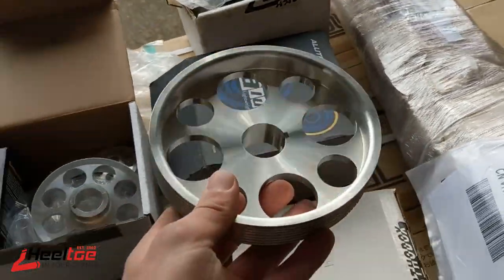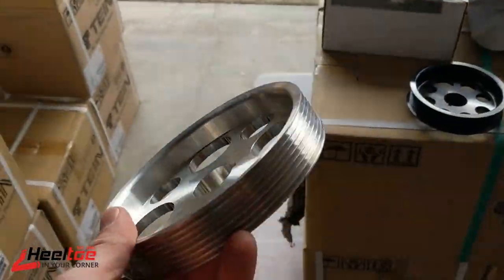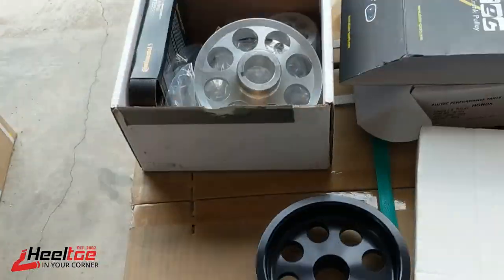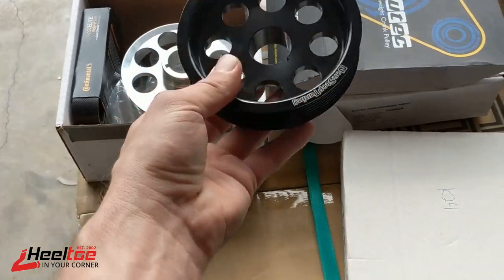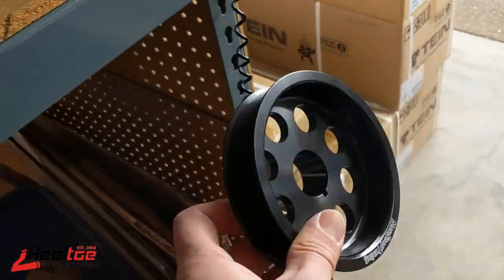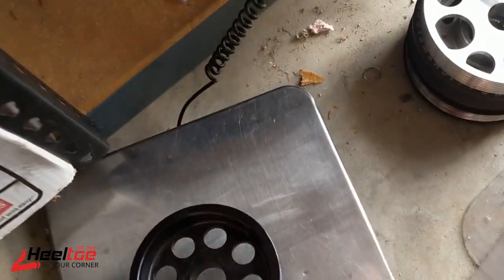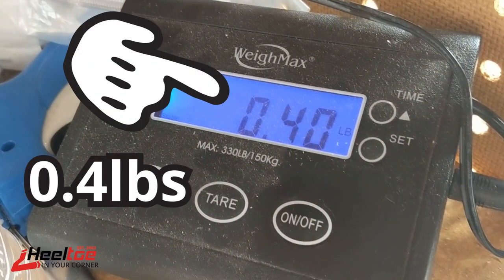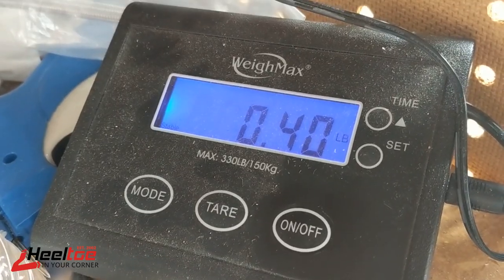It's still a big weight savings — 1.7 pounds is the weight on the Elutec. Also in the stock size arena, there's the Accelerate pulley, which is manufactured by Unorthodox Racing, and when we weigh that one we come in at 0.6 pounds. Of course you can always get an underdrive pulley too. Non-stop Tuning does an underdrive pulley — these are smaller diameters, so less material means the weight comes in at less than 0.4 pounds.